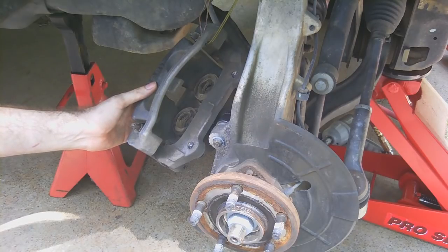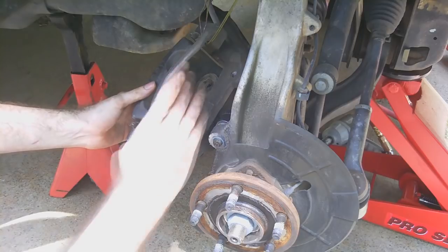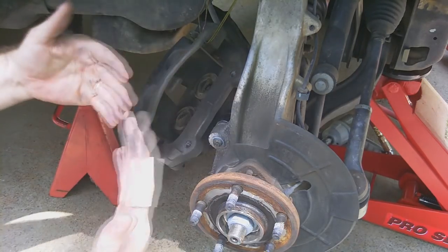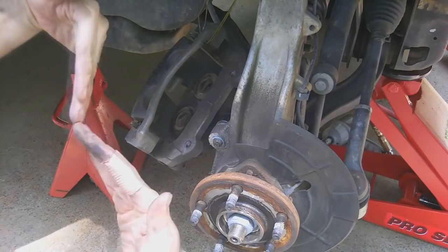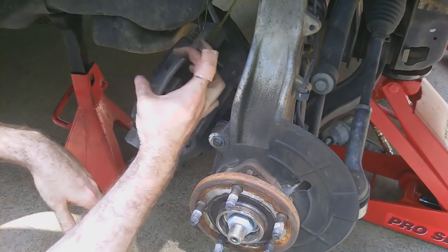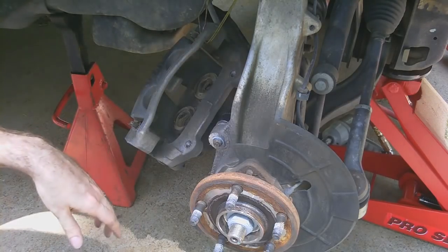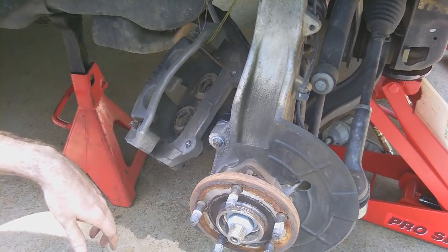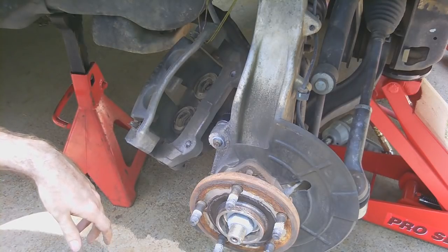A lot of cars and vehicles in general only have one. This is almost kind of a foolproof way of doing it. The pads are so wide that if you just push in one area, it can cause deflection, and the brake pad can only get pushed in the middle. Sometimes you'll just see one big one. You know, it works. This way, you've got two. Even if one freezes up or goes bad, you've still got another one pushing and activated. So I really like this.